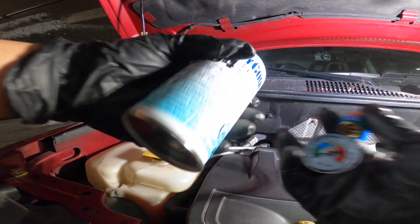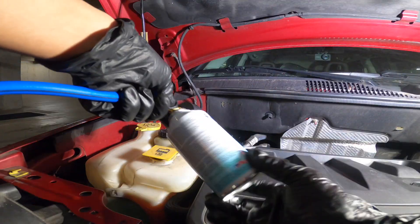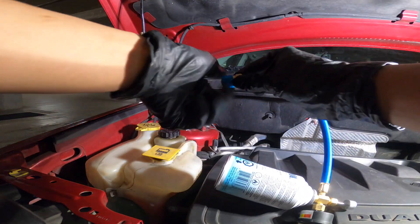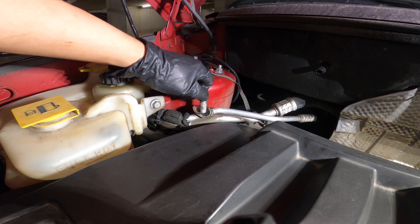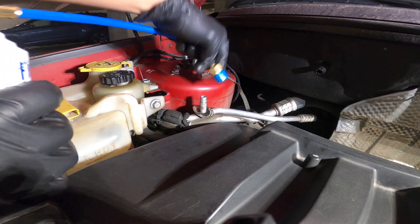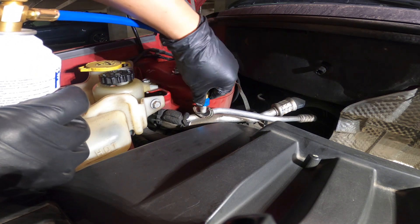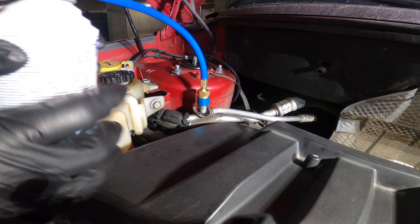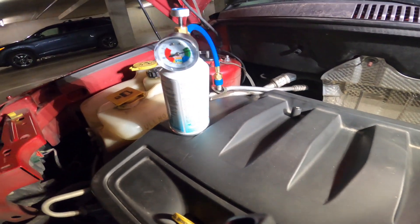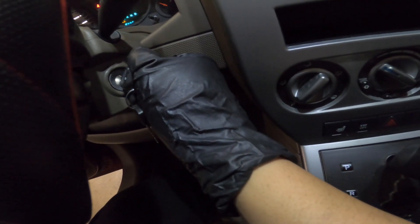It's either a blue or black cap. Upon connecting the hose and pressure gauge to the refrigerant, make sure you just hand-tighten it with no leaks. Remove the low side dust cap, connect the hose to the system by pulling the sleeve towards you and pushing the connector into the low side male service port fitting, ensuring the coupler fits snugly into place. Start the engine and turn the AC to the maximum.